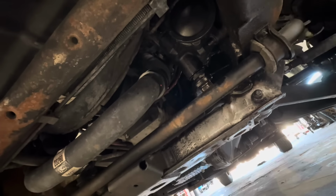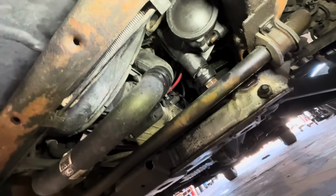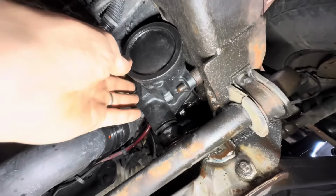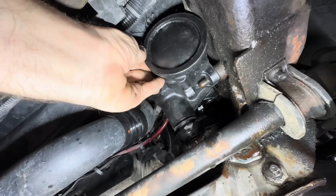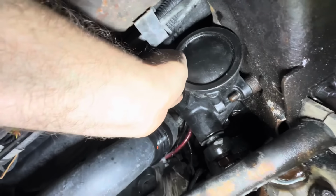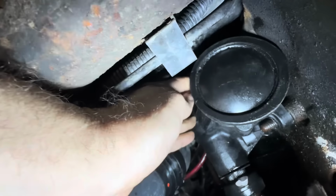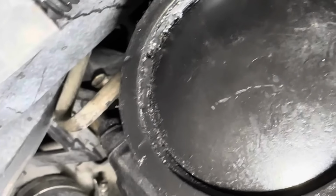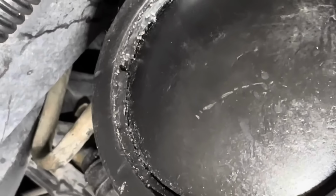We've been looking for about 20 minutes for this thing. I'm looking at everything besides the steering gear, which is what we just put in. I guess right here, I can feel it. That creak, that nasty creaking noise. Watch this. Keep going there, buddy. Watch this right here. It's the end plate.